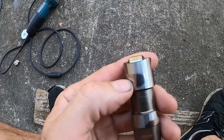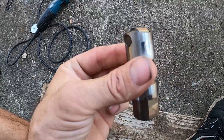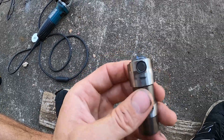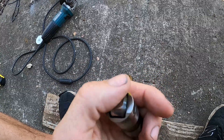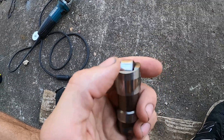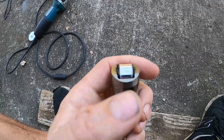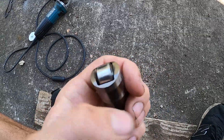You can see there's wear on the side of this lifter, but that's to be expected — it constantly goes up and down inside the sleeve it sits in. What you want to look for is this roller right here. Make sure it rolls nice and smoothly, no scratches, no ground-down divots. You just want a nice mirror finish and it rolls real smoothly — that's a good lifter.